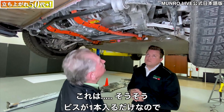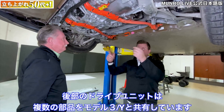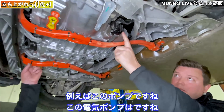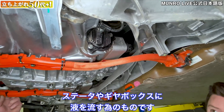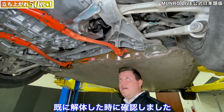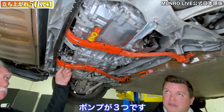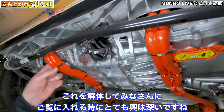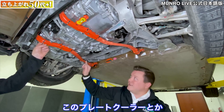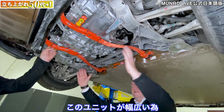It would basically be a tapped nut into the electric motor. The rear drive unit itself shares a lot of core architectural components with the Model 3 and Model Y. You can see these electric pumps — they circulate fluid through the stator and through the gearbox, and they look identical to what we've seen in all Model 3 and Model Y teardowns. We did notice there are three pumps: one on the left side, one on the right side, and one in the center. It'll be really interesting when we tear this rear unit down to show how they're repurposing core components like these plate heat exchangers and fluid pumps.